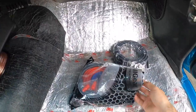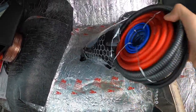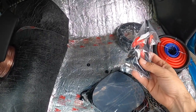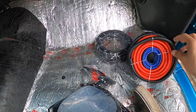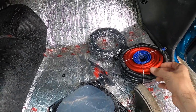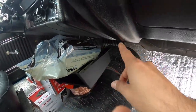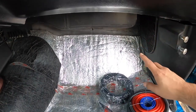I am installing a sub — I already have one installed. I bought this amp kit off Amazon, super inexpensive. It comes with all the fittings you need and zip ties. I'm not going to use the power wire that came with it because I have a longer one that I'm routing a certain way so it's less visible. I could just drill a hole on this side, but now that the firewall is painted, I kind of don't want to drill a hole again. Should have done that before, but we'll work with it.